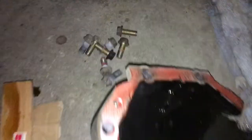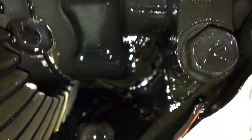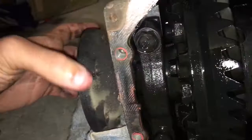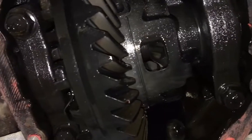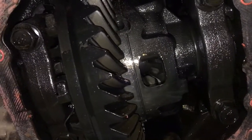I've just popped the end off the bolts so you can see the planetaries and the spider gears inside the center. This is what they call the crown wheel and the pinion — you can see those curved gears down there. As I said before, when you're turning one way the other will turn the opposite way, and you can see that gear action in there. So that's an open center.